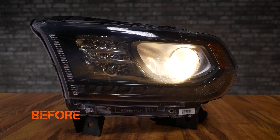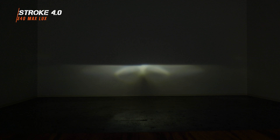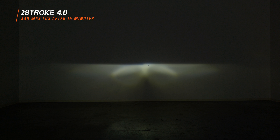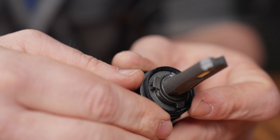There's a common misconception that you can't put an LED bulb in place of your halogen bulb in a projector housing — that's simply not true. Some projector housings don't allow a great beam pattern no matter what LED bulb you choose. Here's a GMC housing — not my favorite beam pattern, but it's still an upgrade over stock halogen lights. With the Morimoto 2-stroke 4.0, I measured 340 maximum lux and 330 after 15 minutes. With the Ultra 2, I measured 440 maximum lux and 390 after 15 minutes.